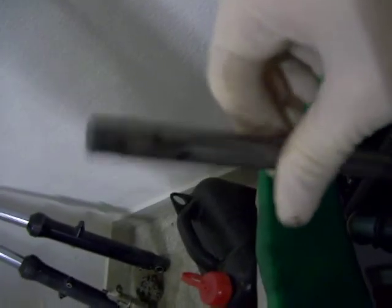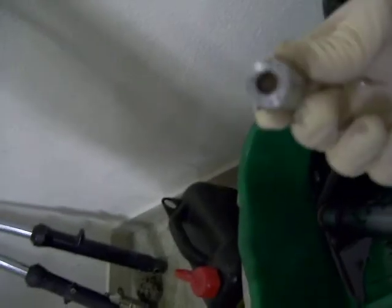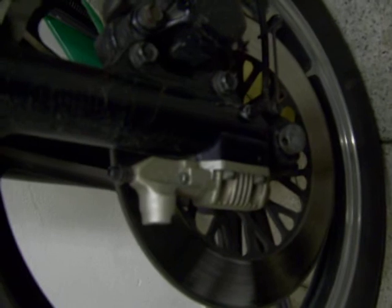The only difference between the left side and the right side is the damper rod. You can see this one has two holes — this is the left side. And if we take a quick look at the right side, you can see the damper rod is slightly different: it has only one hole in it and it has this adapter on the bottom. The reason why the damper rod is different is because the left fork has an anti-dive system — it's blanked off, doesn't work, probably better that way. The right side doesn't have an anti-dive system, so that's the reason why.